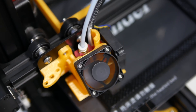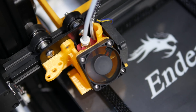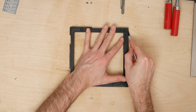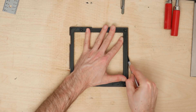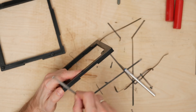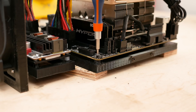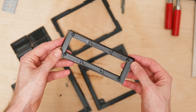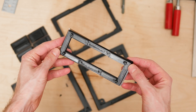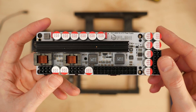All pieces were printed in PETG on an Ender 3 on a glass bed at 0.3mm layer height. I'm not a 3D printer expert, so my prints do leave a lot to be desired, but in case of the frame all I cared about is that it's solid. Notice that the power supply and the mini ITX motherboard pieces feature integrated standoffs. I'm using an HD Plex Nano ATX PSU, which is why the power supply frame support is so small.